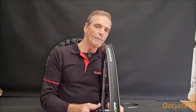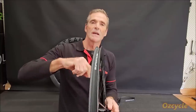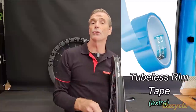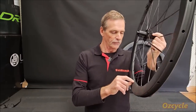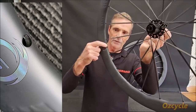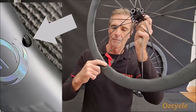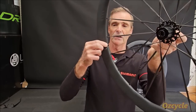The rim tapes are sitting on the rim fine. However, because we've got wide rims — which is the trend these days — the rim tapes are not covering all the way across, so you can't use them for tubeless. If you want to run tubeless on these wheels, you'll need to get a special tubeless rim tape to seal it up. The valve hole is nicely drilled out, nice and clean — nothing's going to catch on there. And from the valve hole you can actually see how thick the carbon fibre is — very thick on the inside, a bit thinner on the outside. That's probably the thickest I've ever seen on a carbon rim.